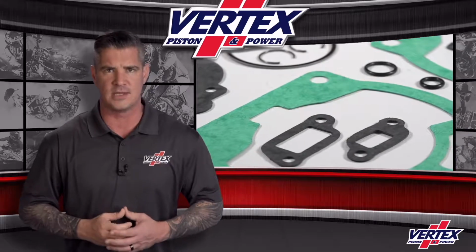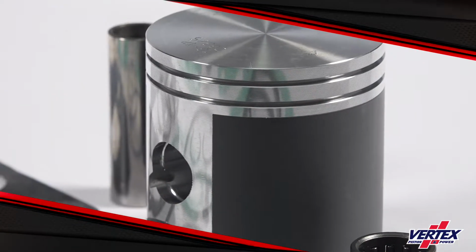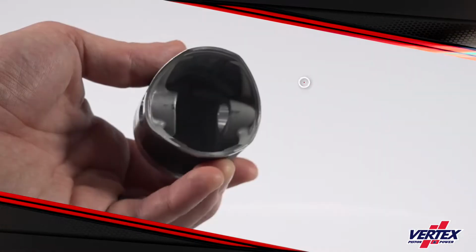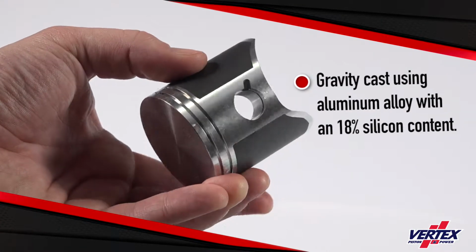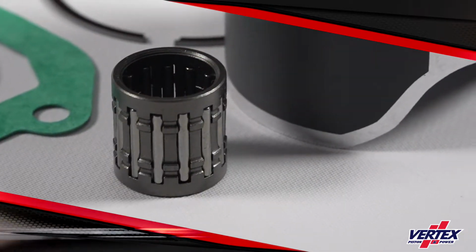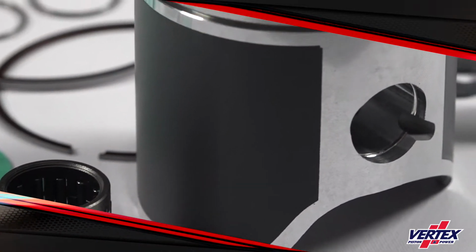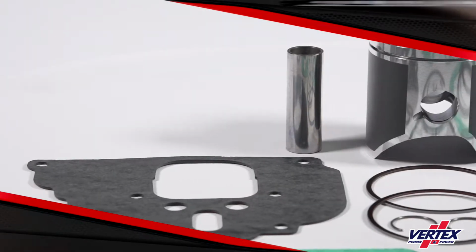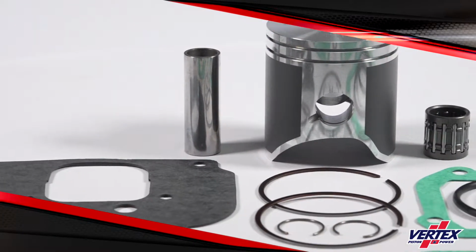Vertex's two-stroke pistons are gravity cast using an aluminum alloy with an 18% silicon content. This is important because silicon decreases the thermal expansion of the piston. The less thermal expansion or distortion a piston has as it warms up means it can be installed and run at tighter tolerances than a piston with lower silicon content, like most forged pistons.